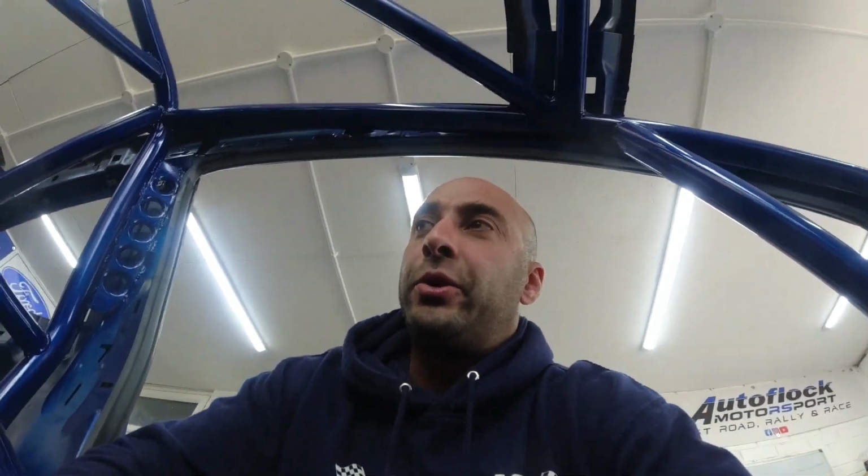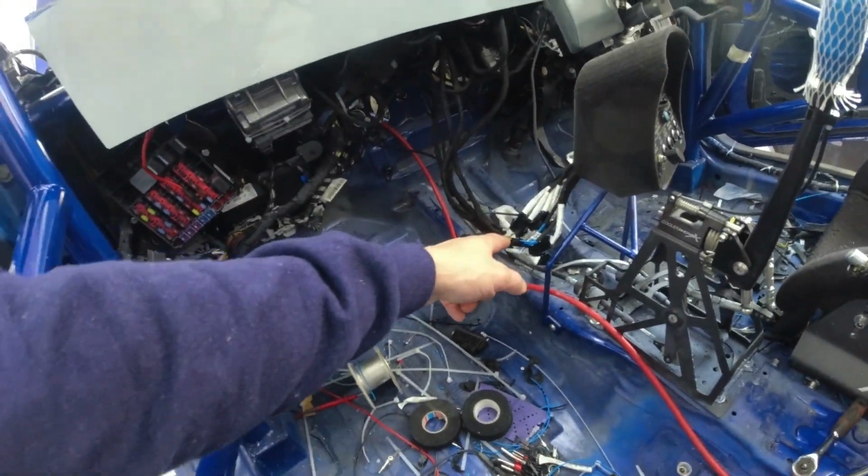But honestly, when you look at people charging who do proper wiring looms, and it's thousands, you think, God, I'm not paying that for a few wires and some connectors. Trust me, it is worth every penny, because this has been a job which I never ever want to do again. If I do go aftermarket ECU, I'm pretty sure I'll pay another company just to do the wiring loom and do it right, do it once, because of the amount of times I've crimped a connector and just ripped it apart, done it again, or just changed my mind. The lengths have been right, like all the lengths here, they look nice and neat now. Four times I've done that. It's opened my eyes to why looms are so expensive, why electronics are so expensive for automotive race cars and track cars.